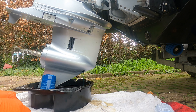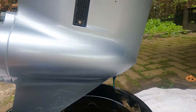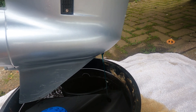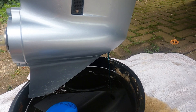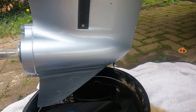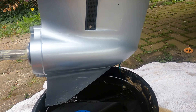There should be two little o-rings as well, which we'll change while that's draining out. What we're looking for with the oil colour is emulsification, which we haven't got any of, or particulates — but the oil looks perfect. So I'm probably not even going to bother with a pressure test looking at the condition of that. The engine hasn't been run that much at all and the seals look fine — pretty new engine. The pressure test would just test PSI vacuum pressure; if we were getting issues I would definitely do one, but with this one I don't think we'll bother this time.